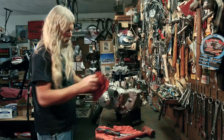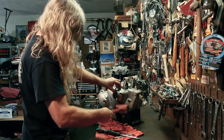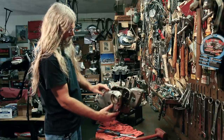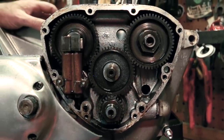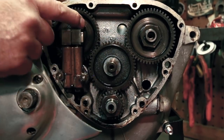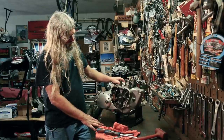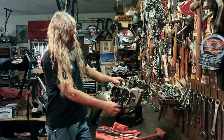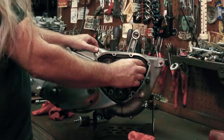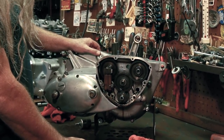Speaking of leaks, we've got a little bit of oil coming out of there. There she comes — and that's what you're going to find underneath there. Cam gears, intermediate gear, pinion gear, oil pump — no big mystery going on here. This is standard thread; these are left-hand threads. If you put your impact on here and try to take that off in the normal fashion, you're probably going to screw it up.